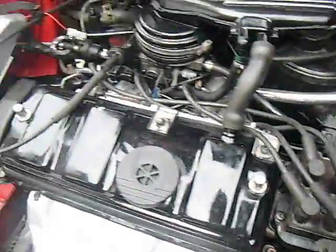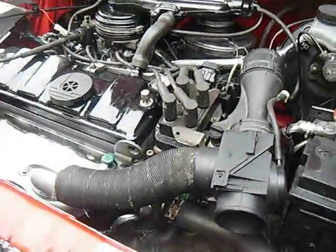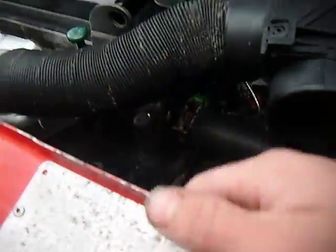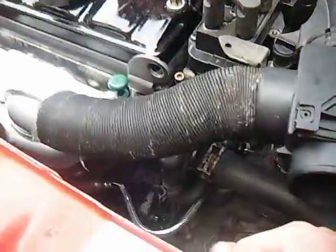so that's how you get your antifreeze out. But also you need to look on your engine for the lowest point of the cooling system, usually a nut or a bolt or something like that. On here, I'll have to try and show you this. On the front of the engine's block, down here, see there's a little bolt. I think it's like a 15mm, so you have to take that off. Now it can be a bitch to get out down there. Your best option, take off the bolt which holds on the dipstick tube, take the dipstick tube out, that's a bitch also.